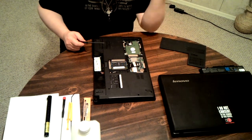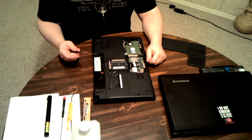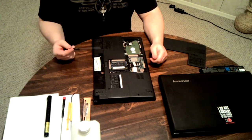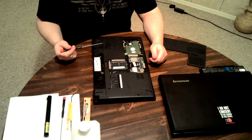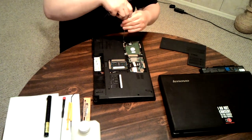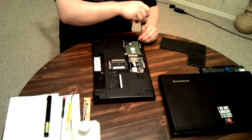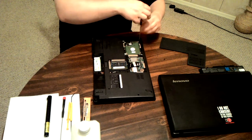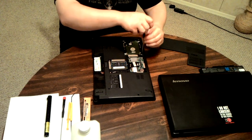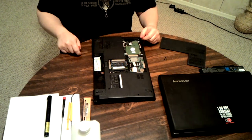And your backup battery, which I don't know why they ever put those visible anymore, since one of these batteries will last you probably 20 years at maximum draw on that battery. And if you ever need to replace them, you're probably wanting to replace your laptop too. So there's really no reason to have that open or easy to get to. It's not that important. Now, with these, you need to take out the screws for the hard drive, because the hard drive screws also hold the back plate onto the main frame of the laptop, which is underneath the back plate.